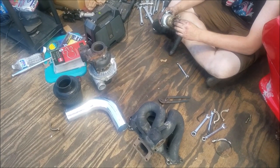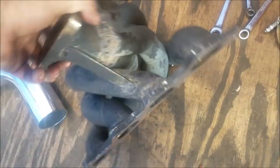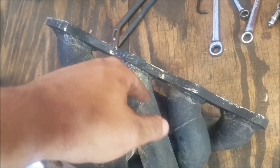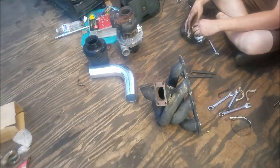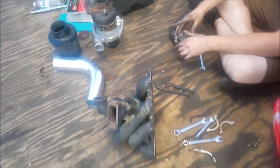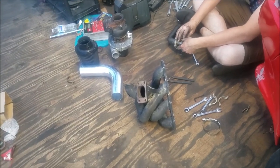It was working — it was just that hole in the wastegate. The back weld broke all the way around the outside, just like last time. It's because the material is paper thin. The new manifold is like two and a half millimeters thick, so that'll be nice.